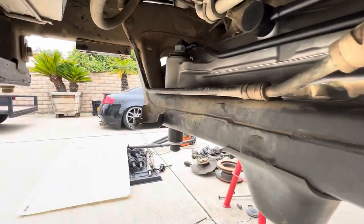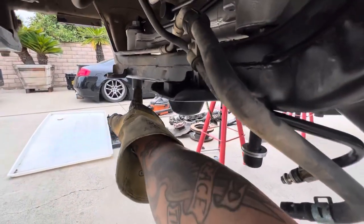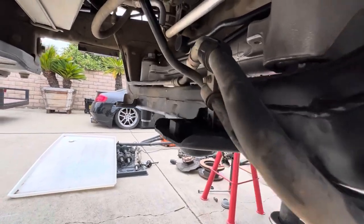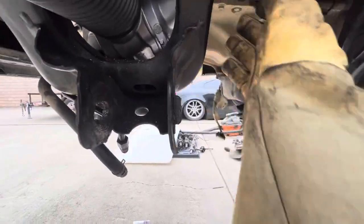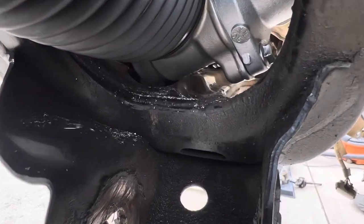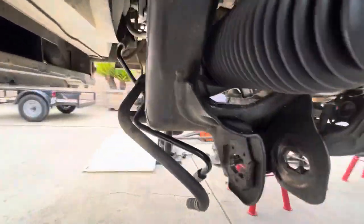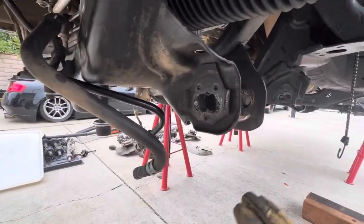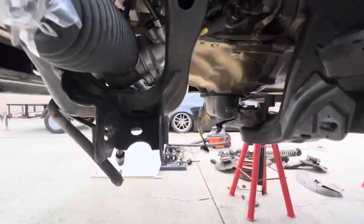I'm gonna test drive it right now — put it back in. My holes lined up — I tried to make it super straight so my holes lined up perfect. I don't have any problems with the hole matching up. I pretty much just tried to drill a straight hole. When I hold it up you can see it's going to be tight but clearing. Perfect hole right there — so that's clearanced. I'm going to tighten it and then get my sector shaft measured out and start looking at that.